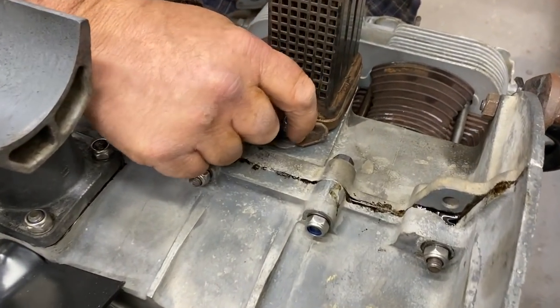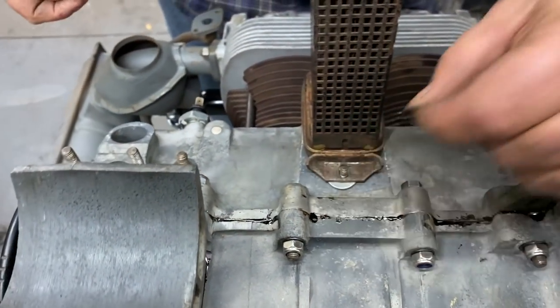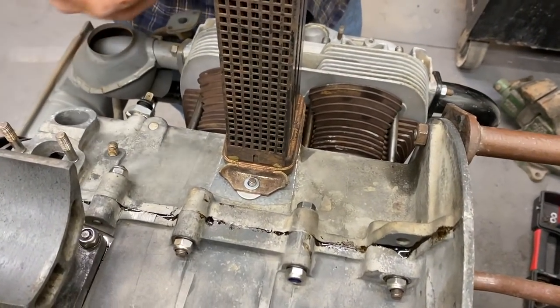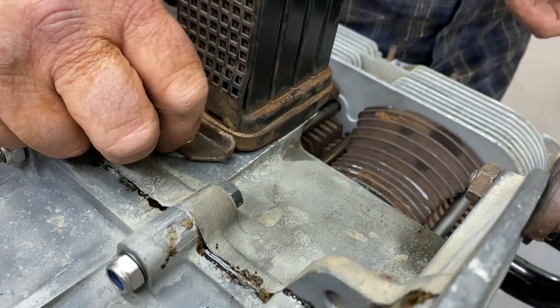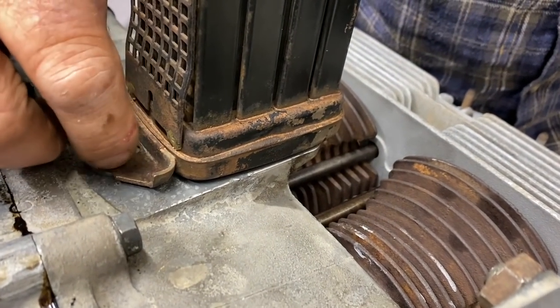Someone commented about the locking nuts melting, which won't happen. They don't get hot enough. I wouldn't use them on the exhaust, but the case never gets that hot. So you should be fine with a lock nut. We've used them for years. I've never seen one melt, but if they do, it'd be an indication that the motor's not tuned properly.